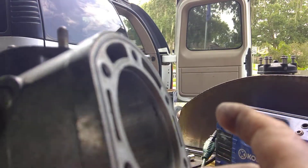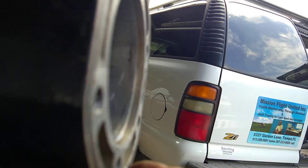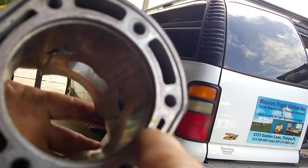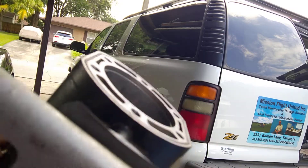There is a small distortion — let's get the light on it just right. Right there, there's a little tiny distortion, and that little tiny distortion is actually lined right up with this little hole right here, and that little hole right there is leaking straight through. I don't think this casting can be fixed. We may have to send this out to see if it can be repaired, or we're just going to have to try to find a new casting.